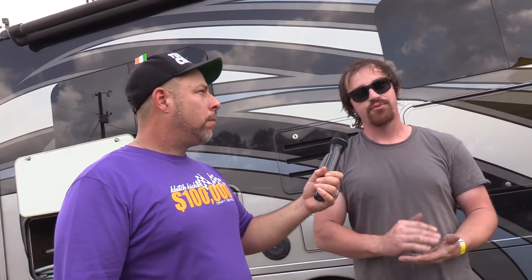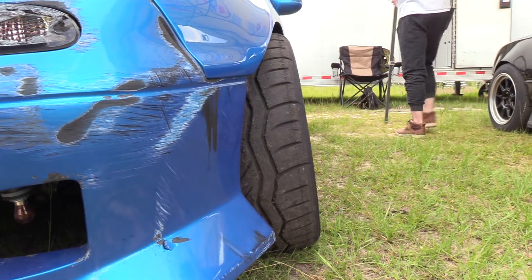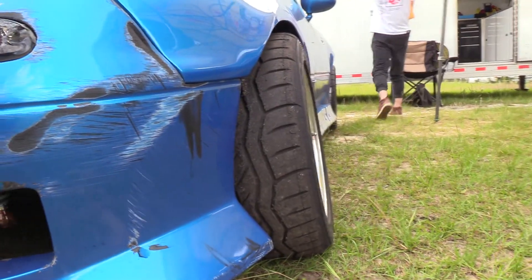Before that we had cut knuckles and that was pretty much it. So there are a lot of people out there that were afraid to use a Miata. Is there anything you could tell those people — tips or anything you could provide if they're looking to get into a Miata? The biggest thing I would say is alignment is really crucial on them. You need to get a little bit of toe out in the front, a lot of toe in on the rear to kind of take the snap out of the car. It makes it a little slower on transitions and easier to drive. That's probably the biggest tip I could give for Miatas specifically.